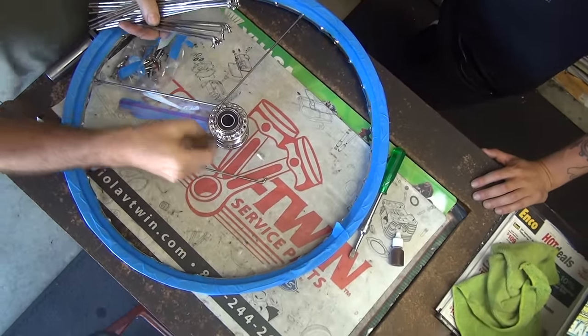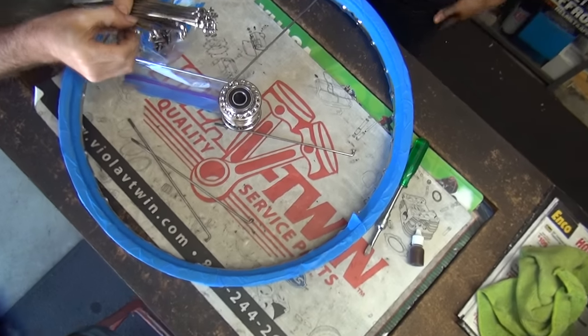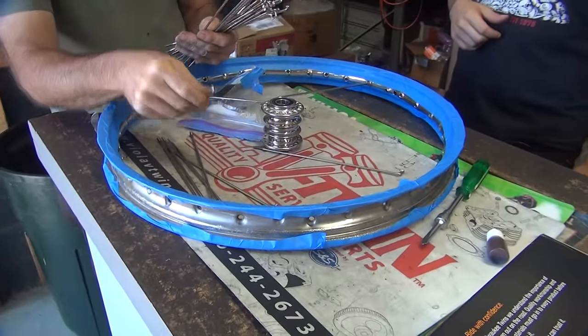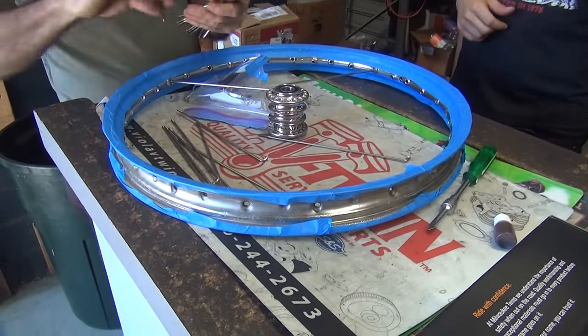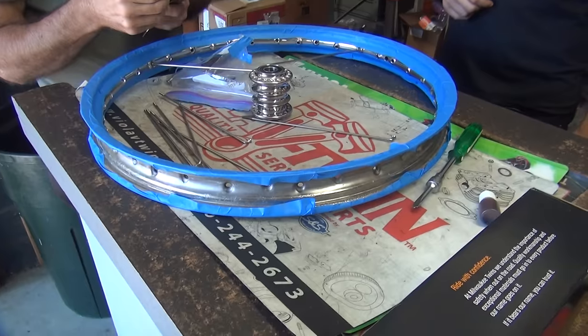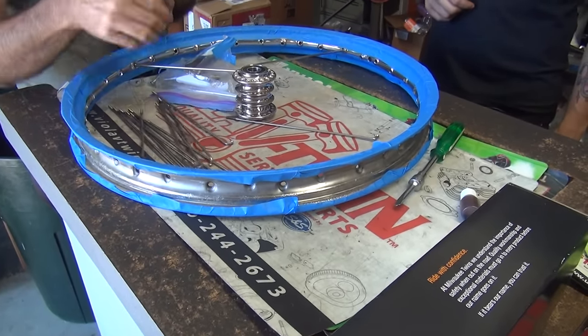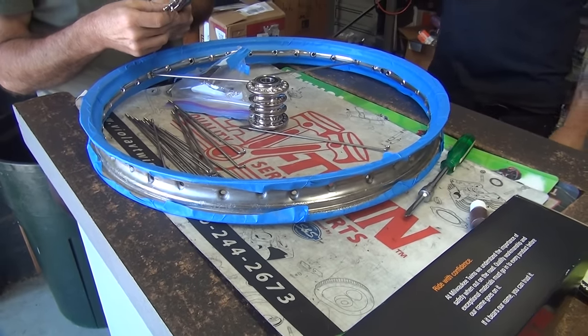Now it should be half of these spokes are over 90 and half are under 90. So you have to go through there and look at all the spokes and see what you have. Here's another one - over. That one's under. Oh, these are neutral. These are bending either way I guess. I don't see too many of them are over bent either. Most of these are pretty neutral looking. So neutral is what? 90 degrees? Yeah.